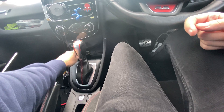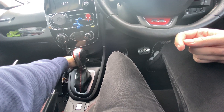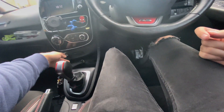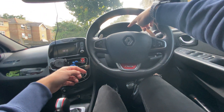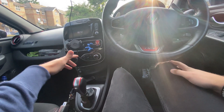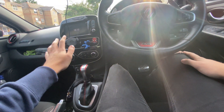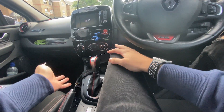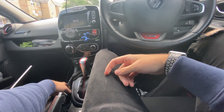The OBD reader is plugged into the car. We need to turn the ignition on — I learned this from Mike when I went out to see him. Put the key card in the car, put your foot on the brake, put the car in drive, hold down the start button. It should say on the dash 'remove key card.' Foot on the brake still, put the car in park, let go of the brake, and then the ignition will stay on — you don't have to touch anything.